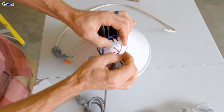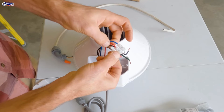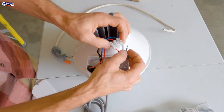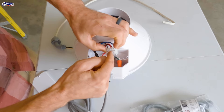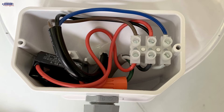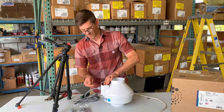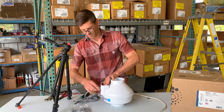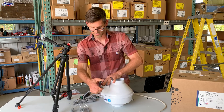Next, the black wire on the cord goes to the black and red part of this terminal box in the middle. I'm going to put on that wire nut to avoid a loose wire in there. Then we're going to put this terminal block onto these two posts and line it up with the holes inside. Now that we know everything fits and we've got enough slack, we can tighten this up — this is what actually holds the cord in place and provides the locking mechanism.